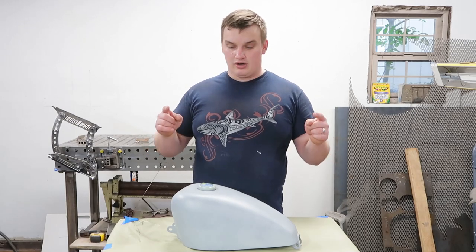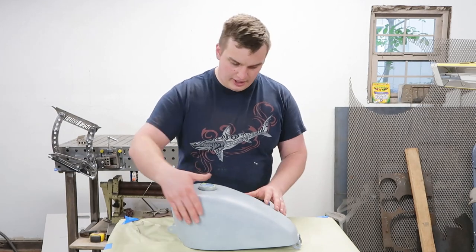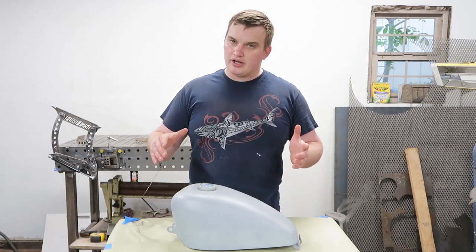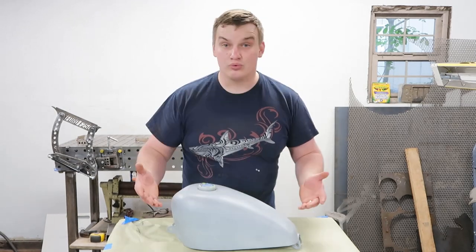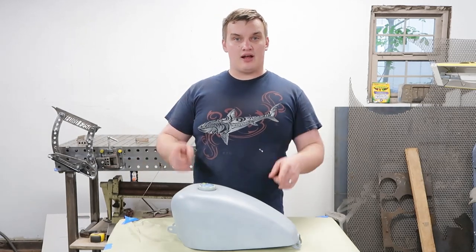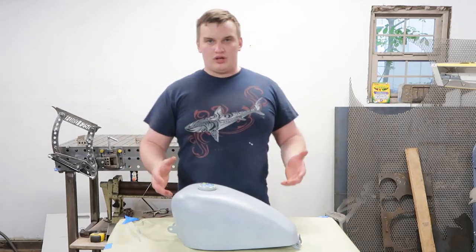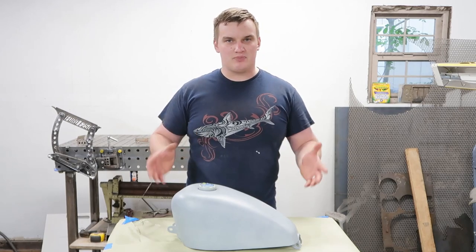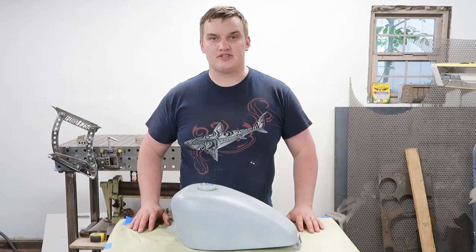So what we're going to do today is spray some 2K primer on it, block it out, and see if there's any blemishes in the tank after we hit it with the 2K primer. We'll do any body work that we need to — I don't think we will, this thing's in really good condition — and then we are going to paint it and color sand it. We're going to try to get away without doing a clear; we kind of want the old school look of just a solid single color, and the customer is going with white. So let's get started on this tank.